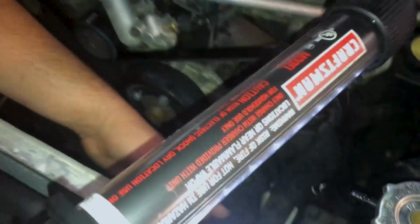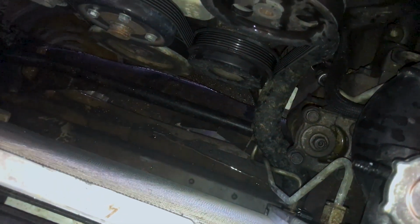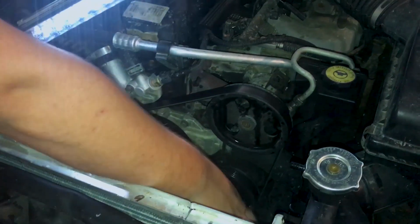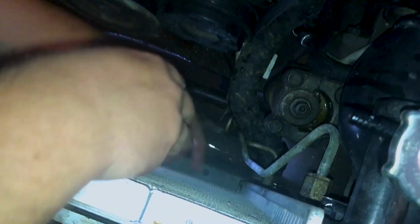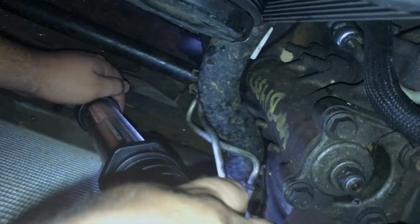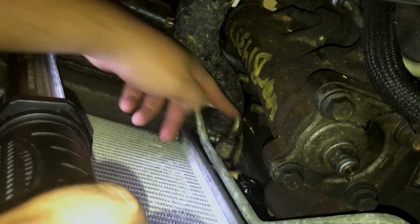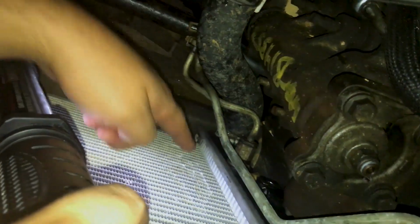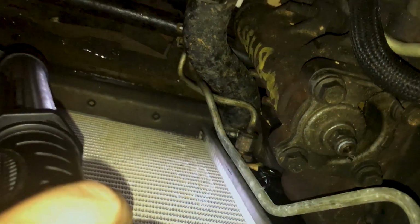This long, flat metal piece here is our radiator. And to get this fun friend out, we're going to have to disconnect 1,000 different bolts and these hoses here, which is why we're replacing this radiator. If you can see this fitting down here on the bottom, it's made of brass. Can you see this fitting right here? Yeah. That fitting right there was peeing transmission fluid all over the place, and it's not from the line itself, it's from this little fitting washer back here, which is part of the radiator. So we're going to be replacing it because of that.